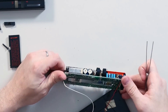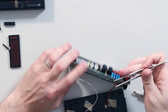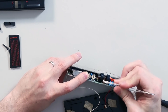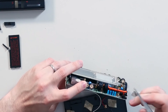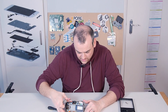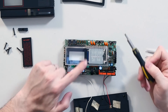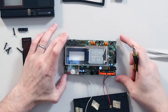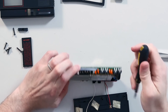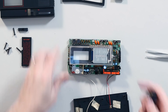It looks like it survived incredibly well — I'm not seeing any significant signs of age. The sides are getting a bit grubby and similarly the power contacts. Maybe a bit of contact cleaner — let's see if we can get it turned on and tuned into the N64. I'll cycle some of the pots to make sure they haven't seized, then return them to their original location and see if we can get the picture fully filling the screen.